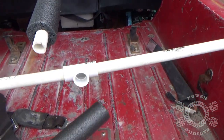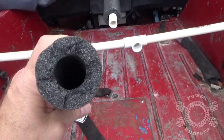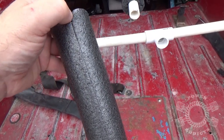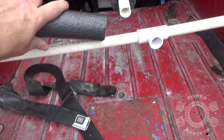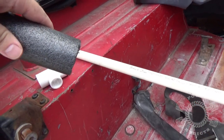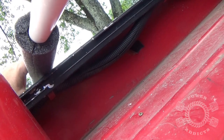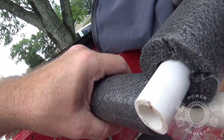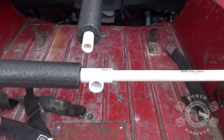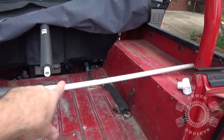To help protect your top, get you some pipe insulation wherever you've got your PVC pipe — at your Lowe's or Home Depot. This is three-quarter inch insulation — yes, I said this is half inch pipe here, but you want the three-quarter inch insulation. It's got that slight little split, and what that's for, you can stick your finger in and just split this pipe and slide it over top of this right here. Now, don't split it open if you're doing this project — leave it enclosed. Take this, slide it on the end, slide it down. I've got a little bit hanging out right here because there's a T-fitting going on right there, so put on one more piece, and that will complete the fabrication of your bow to allow runoff.